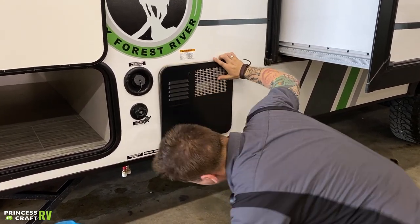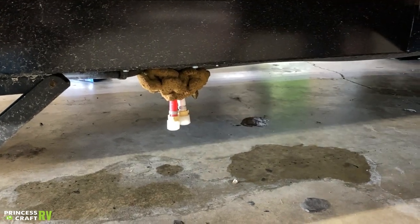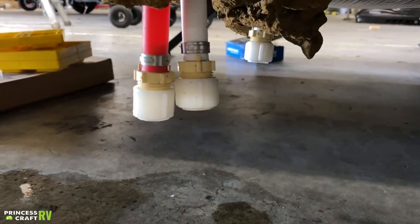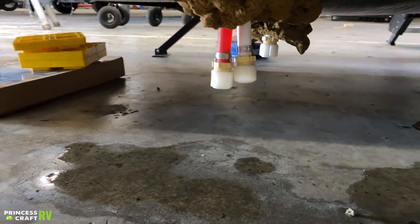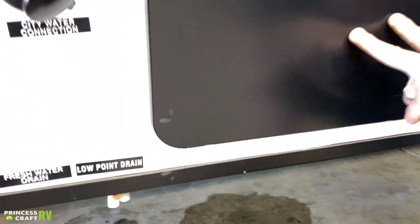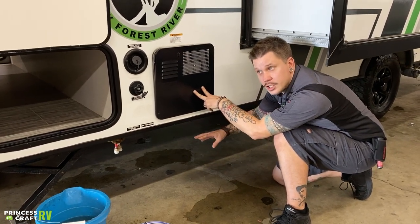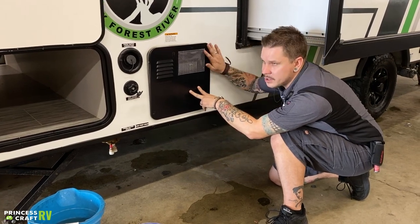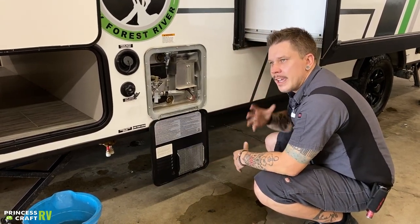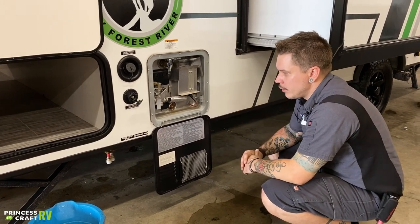If we get down low here, we see not only these two water lines, but there's going to be one further back — that one is going to be your freshwater tank drain. The two closer to us are going to be your low-point drains. The manufacturer recommends that any time the unit is going to be in storage for more than seven days, it is very important that we purge all the water from the system. To do that, we're going to remove the plugs from those three locations — the freshwater tank if it's been in use, and then the low-point drains to drain all of that in-between plumbing. Those low-point drains are the lowest point in the unit's plumbing, so everything between water source and fixture is going to be drained from that location.